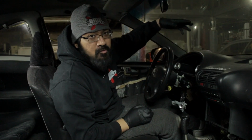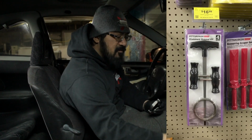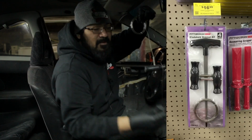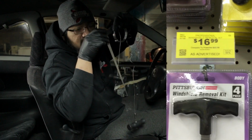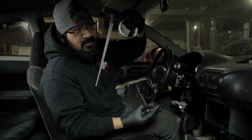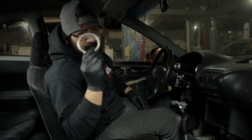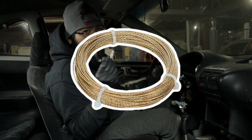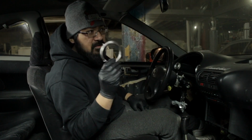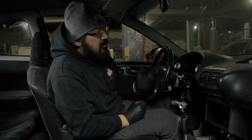And I also want to remove the windshield. How we're going to remove the windshield is we're going to use this nice little kit that I got from Harbor Freight. I don't have the packaging anymore, but I'll put the links in the description. Basically, it's two handles, this little knife stabber inserter tool thing, and it provides you with a roll of piano wire or windshield wire that you can use to cut through the glue around the windshield. So let's get into it, and I'll show you guys how to get this done.